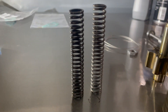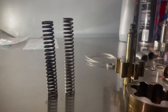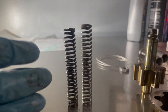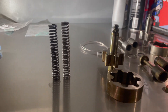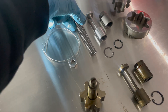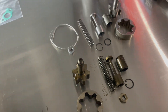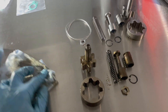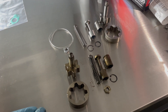Here's the old spring compared to the new spring. Let me set these up so you guys can see — there is a clear difference between those coils. The old one is obviously worn out over time and the new one is in its current shape. I just like to go over everything because these cars do idle super low. People see like five to seven PSI at idle, which is scary low in most cars, but that's just where these cars like to sit.